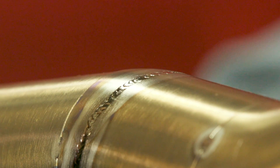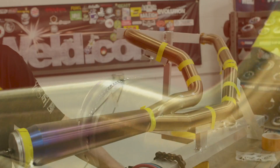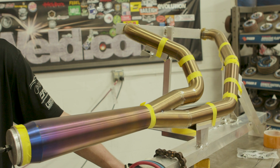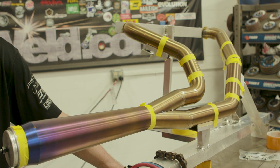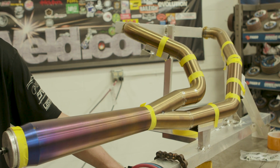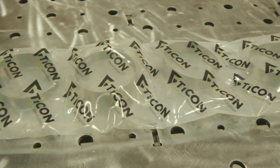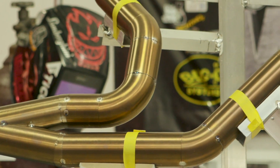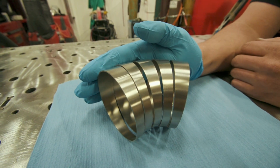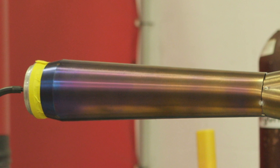Tell me about the cuts and design — do you start from a template, a print, or work off the actual engine? This system was mocked up on the bike first — this is the first one and hasn't even been released yet. It was built on the bike, then we take it off and build a jig to weld it out, keep it all together so we can build more. All the fittings here are from Tycon — their mandrel bend fittings, pie cuts already cut clean, straight tube, and this megaphone reducer they make as well.